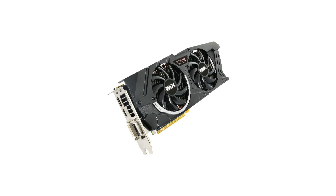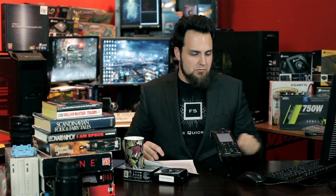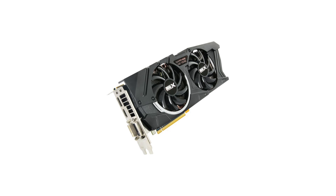For the video card I'm grabbing the Sapphire Radeon HD 7970. It's a monster with three gigabytes of GDDR5 and it pretty much beats everything out there. It overclocks — it gets hot, but you can overclock it. What I like about this particular model is that it has two fans and copper heat pipes so it runs a little cooler than the reference card. As far as high-end graphics cards go, you get more per dollar with this card than just about anything. If you can't afford it, the GTX 670 is a great alternative, and the Radeon 7870 for a couple hundred bucks is amazing. The 7950 is good too.